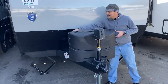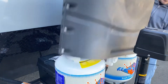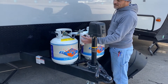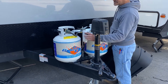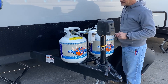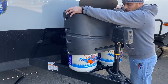Our LP tanks — the cover opens up from this end. These are refillable tanks, so you can take them into Ace Hardware or anybody that refills LP. This here is your selector switch. Right now the selector switch is pointing at this tank. When this tank turns red, we're going to swap this one over to the other one and open that valve up. Try not to do the middle — that way you don't play a guessing game on how much LP you actually have.